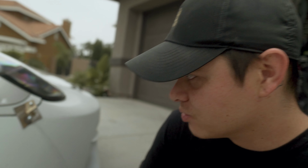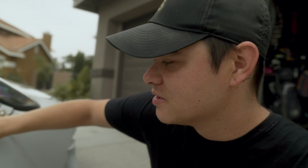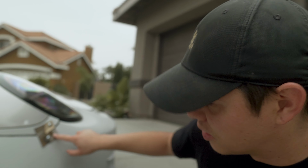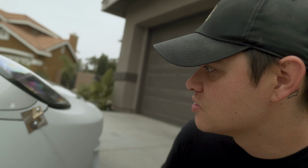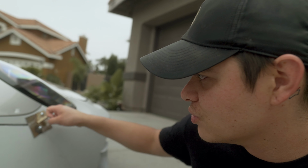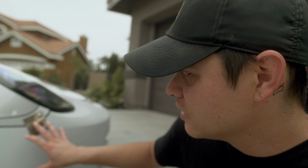So I'm gonna pull this headlight out, and probably put tape on the back side of this bumper. While this plate is still on, I'm gonna take two sections of Bondo glass, which is Bondo infused with fiberglass. That stuff is incredibly strong, and I'm gonna use it to hold its positions. Last week, you saw me drill this piece of metal into this bumper, and I have a little bracket right here. These aren't permanently attached to the car, and if I were to pull it off, it has the possibility of moving, right?